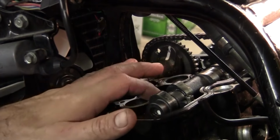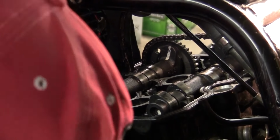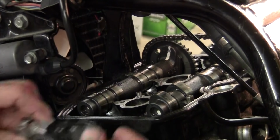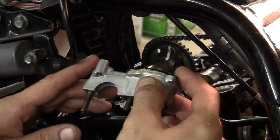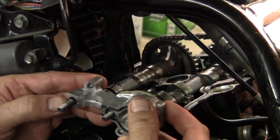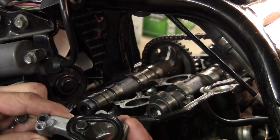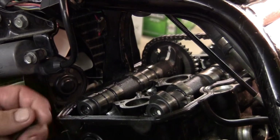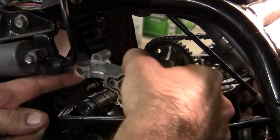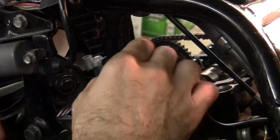We'll lay them in place in here. We'll take the locator pins. It'll help us. This is number one. It says number one on it. We got a longer bolt in the front. We got a larger locator pin in the front. And obviously there's a spark plug hole, so you can't really mess this up, the direction or the configuration. Okay, so number one. Locator pin here and here. There's one in the block and there's one here.